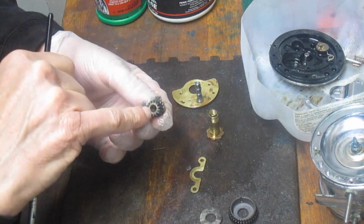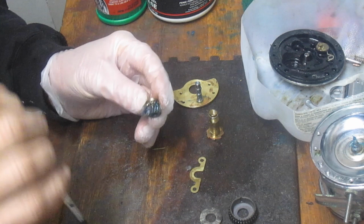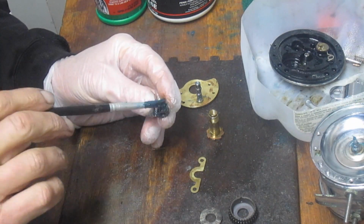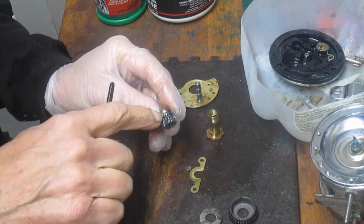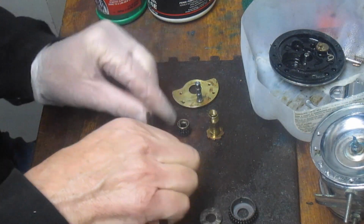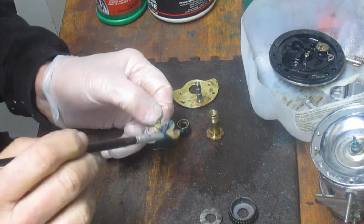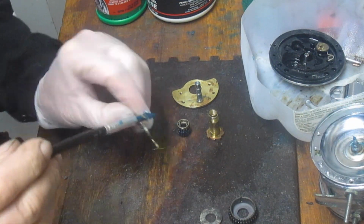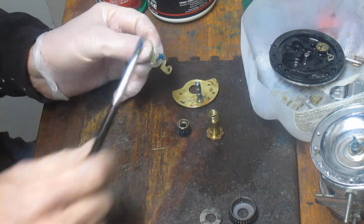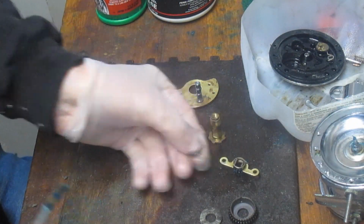You don't have to do anything on the inside. You've already put grease onto the spool shaft. You don't have to do anything over here. Nothing engages. If you can get some in the slot, that's fine. That slot is for the yoke, so if you grab your grease and just kind of put it on the yoke, you don't have to worry about trying to work it into the other slot there. And then once you do that, then just simply put that through the engagement.